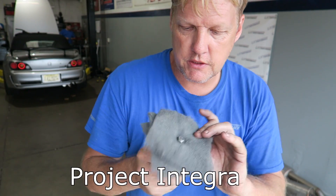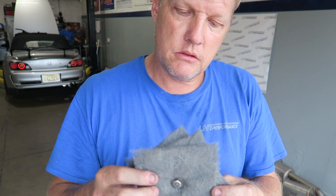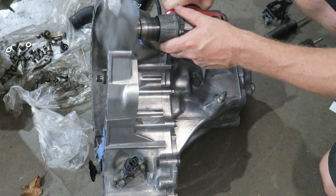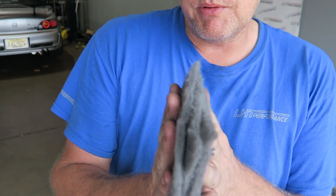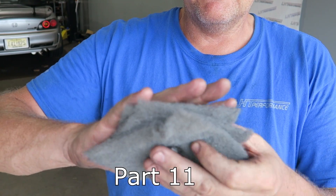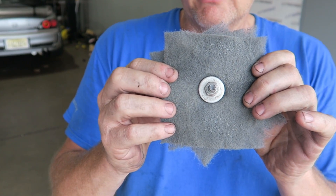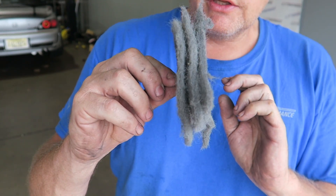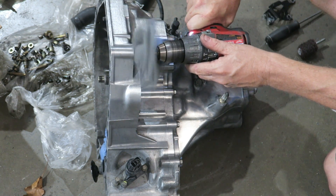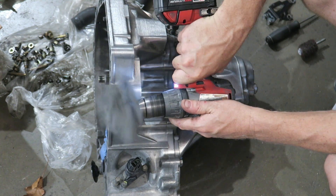Here's another one of my little trick pieces — I call it a stainless brush, but it's actually scotch-brite. It's pretty simple. This is three pieces cut into three even squares, kind of offset so it makes a bit of a circular pattern. Drill a hole through it, put a nut and bolt through there with a washer, and you can put this on the end of your drill to brighten up aluminum and stainless and give it a bit of a satin finish.